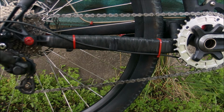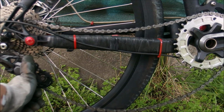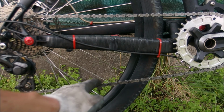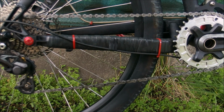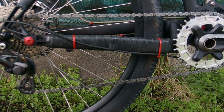There is a single directional friction clutch which you can buy off the shelf inside of the pivot of this derailleur. It works in that it resists the movement of the cage in this direction. However, it doesn't restrict the return movement, which means that every time you want to pull the cage, you're going to dampen the movement just a little bit. It works very similarly, although on a quite different principle, to the rebound damping on your fork. Nothing, however, comes for free.